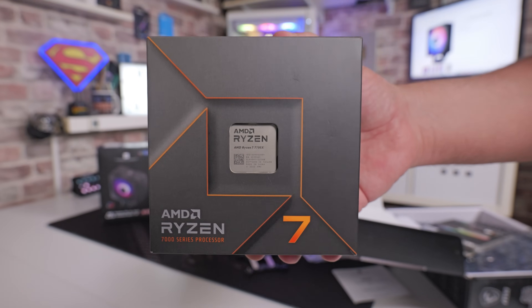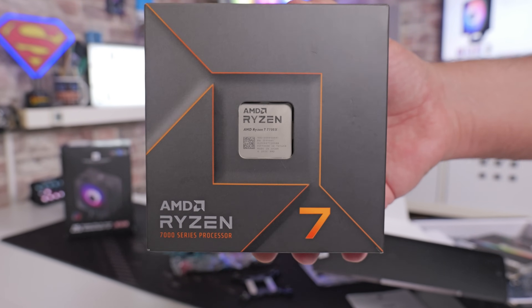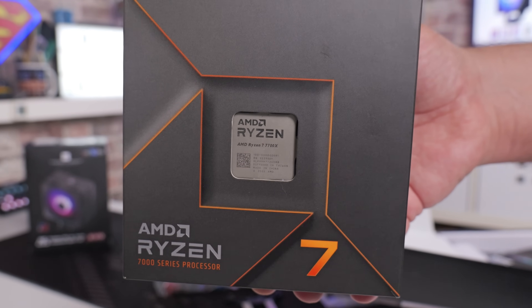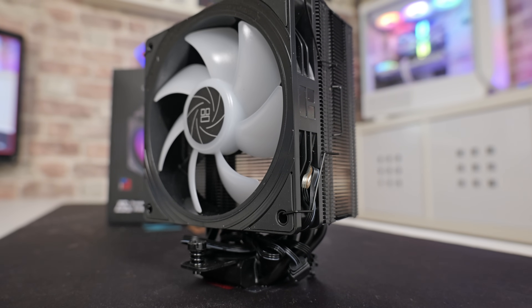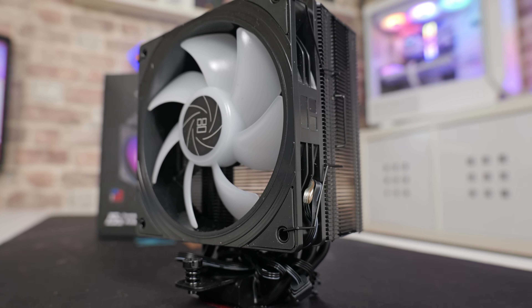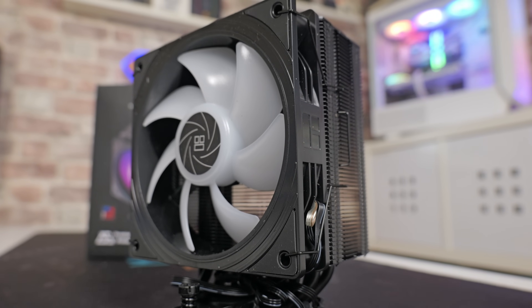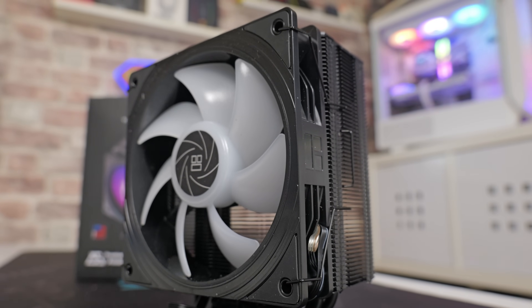So in today's video I'm going to do the unboxing and show you what you actually get. We'll also be doing some thermal tests and some noise tests with a Ryzen 7700X, which I think is a good choice because most people spending around about £20 on a cooler aren't going to be overly taxing it. The 7700X does have a tendency to try to reach 95 degrees Celsius regardless of what is going on. So if you're looking at a newer processor like the 9600X, those are actually a little bit cooler than the 7700X. We'll also be doing a full installation guide, which is going to be in a separate video. But let's head straight into it and see what we actually get in the box.